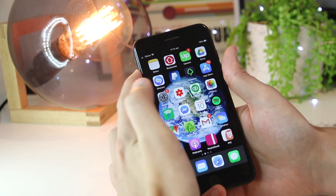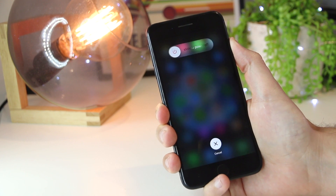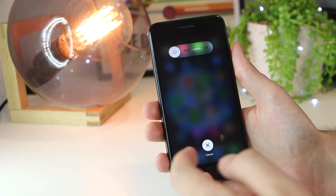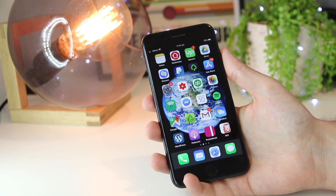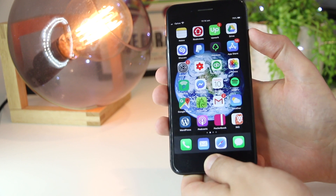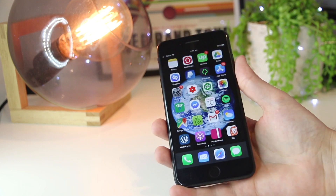So I'll just do that now — up, down, then press and hold the lock screen button. I'll keep pressing until my iPhone powers down and then restarts. And if you're on an older version of the iPhone, you can restart your device by pressing the home button and the lock screen button together for about 15 seconds until the device restarts.